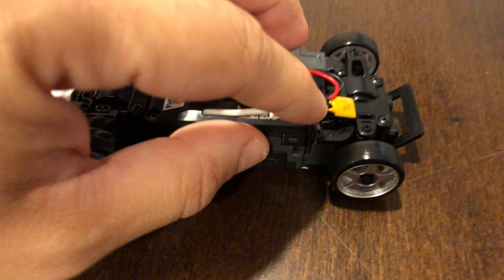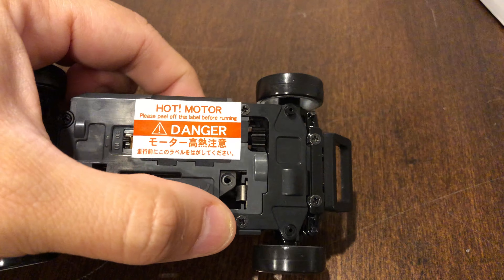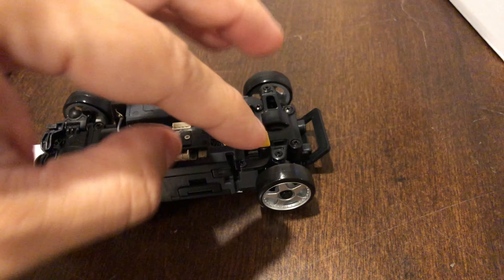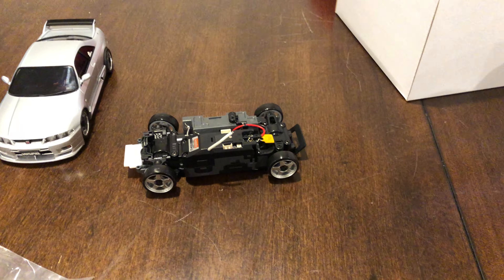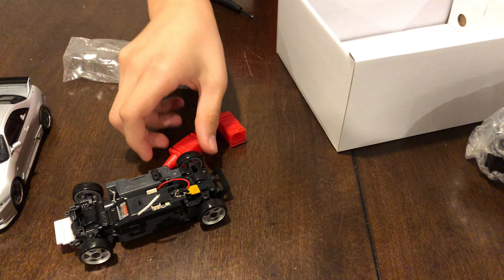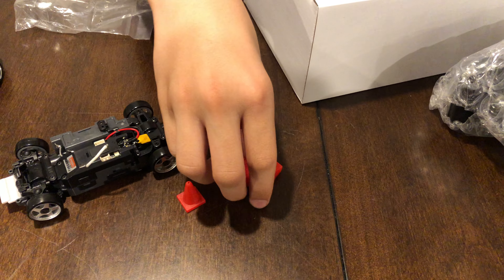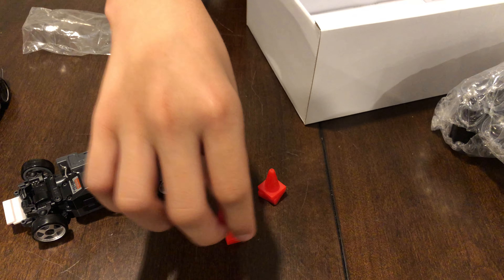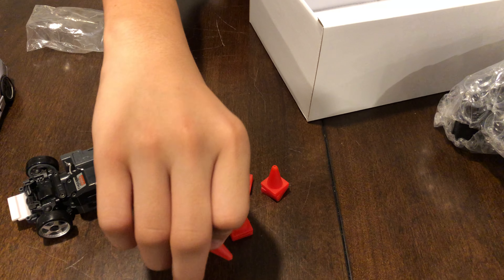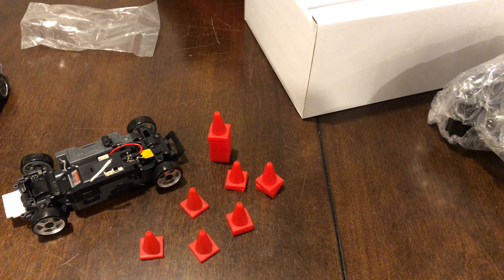As you can see the R33 — I believe it's like 90 millimeter or bigger, maybe 94 — and this one's like 98, so you have to extend the chassis out. When you do that, over here you've got a screw at the top, screws at the bottom, you take those off, slide this back, change out the spur and you're good to go. Little Shadow got the cones — extra cones — so now we're going to have a bunch of them. We added them to our collection and as you can see we've got quite a few already.